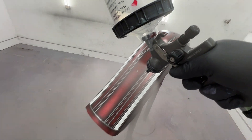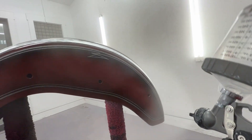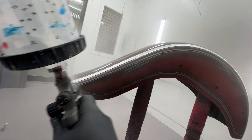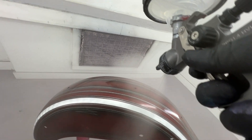With Limeline acrylic urethane clear coat, the average flash time is between 8 to 10 minutes at 75 degrees. However, dry times will be different depending on factors like temperature, humidity, air pressure, and how heavy the coats are applied. I prefer to spray 3 to 4 coats total, though 5 coats would be the max in one session.